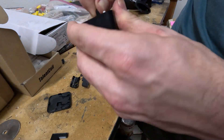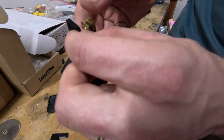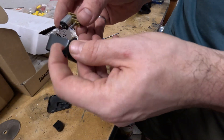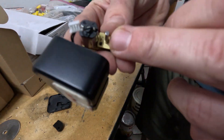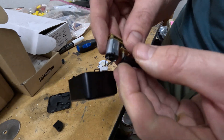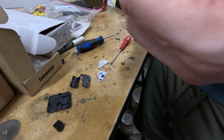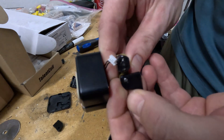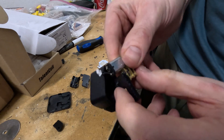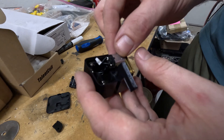It's a small, fragile machine. The motor doesn't come completely out, which is fine — it comes out enough to remove the arm. Take that arm off, set it aside, and put your new 90-degree arm in. There's a flat on the shaft that you need to match to the flat on the 90-degree arm. Make sure you don't go too far onto the shaft or it won't fit back in the housing.